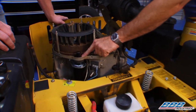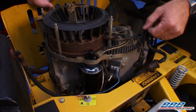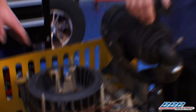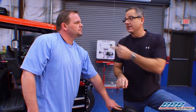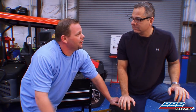If you look over here, what we have is a pinion. It's always a good idea while you've got it apart to test it and make sure that pinion contacts the flywheel good. That one looks good. Pinion contact is real important — you saw that pinion come up and contact the flywheel. Here's a tip: if there's a high-pitched whine when you're cranking, usually that pinion is too far away from the flywheel. On the other hand, if you release the key and you get that high-pitched whine, that's because it's too close and the pinion is hanging up with the flywheel. I'm glad this one's in good shape — once we get this back together, my grandma's going to be happy so I can go cut her grass.